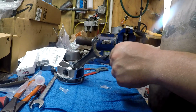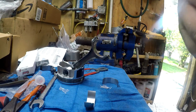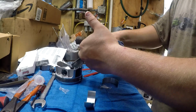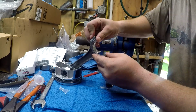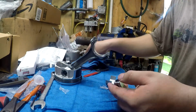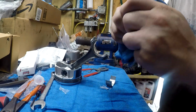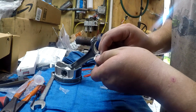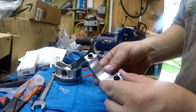Okay, so the bearings install exactly the same way as they did on the rod journals, which is, let's get in there with a clean rag, make sure there isn't any dust on there. And you just take them and pop them into place. There's nothing else to it. You grab your cap, also wipe it down, make sure there's no new dirt in there. Then you take it, same idea, line up your groove, right there, and then pop it down into place, and you got it.